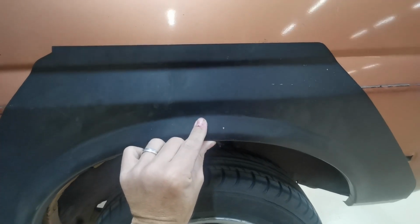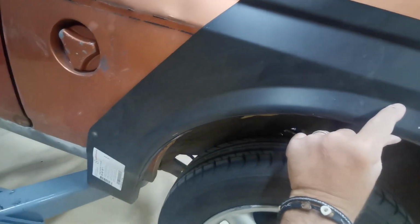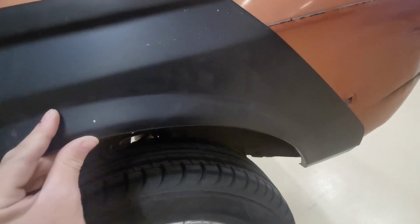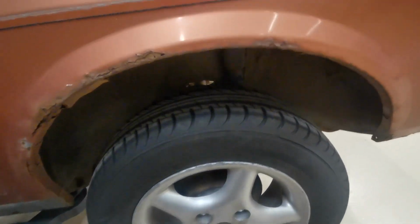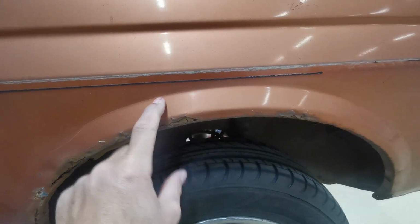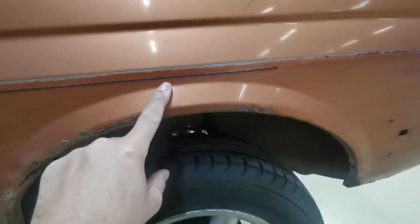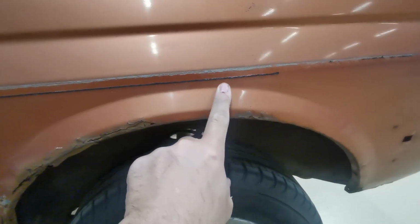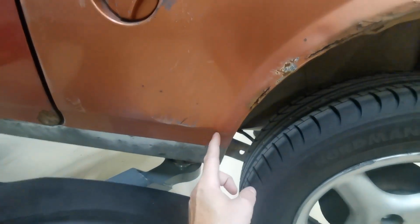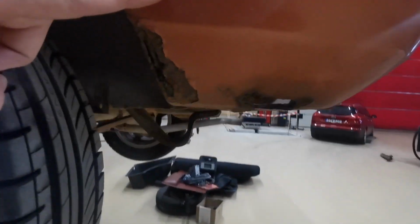I'm going to take it down as close as I can. I'm going to use that edge as much as possible and follow it all the way around, which means that the warpage risk is a lot smaller. So I'll be cutting along this edge here, which means that I'll be able to cut off just that little bit. Any filler will all be masked off by this joint here. So I will probably start from about there, go all the way up, all the way down, and then I need to do that bit.